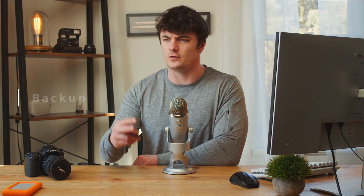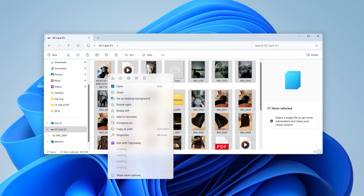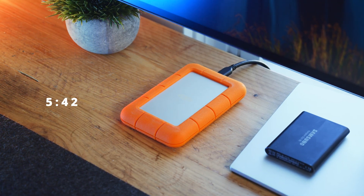So let's get started with the first step in the process, which is to back up the data on our SD card. There are really two ways to do this. First, if you actually still have full access to your SD card through Windows Explorer, simply copying your files and data over to a separate drive for safekeeping during this process is really all you need to do, and you can skip right to the restoration phase. However, if we can't access the files on the card directly, then we need to back it up by creating a disk image of the card and pulling the files off of that instead. Creating an image of our card allows us to copy all the data off the card without being able to access it — we're basically just bypassing all the errors — and it's a much easier and safer way to work with the card and the data so as not to corrupt anything else or damage anything further.